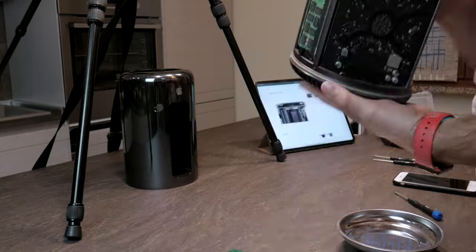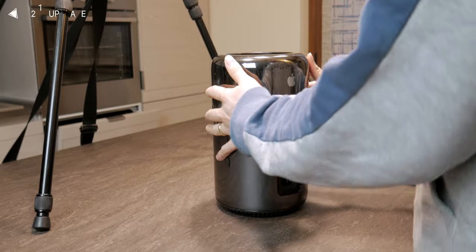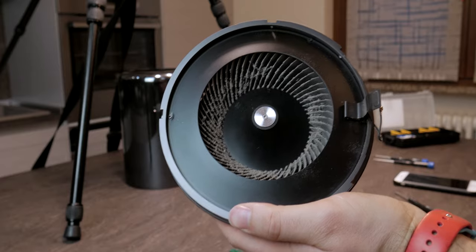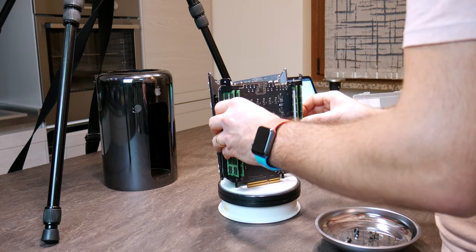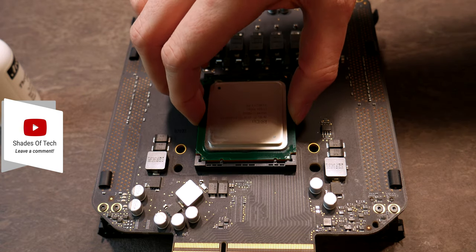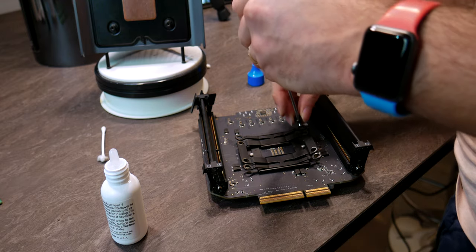If you are interested in the upgrade process, be sure to watch my next video where we will focus more on the steps and experience of the upgrade, while in this video we'll focus more on the performance improvement. To access the motherboard you have to remove the metal cylinder-shaped cover and then disassemble almost all the Mac, starting from the top single fan and then dividing it from the I/O and the dual GPU assembly with the heatsink. Once you free the CPU it's just a matter of removing the old and inserting the new, and of course reapplying the thermal paste. For me it took about an hour and I found this process really simple following the iFixit guide — it was even simpler than the iMac upgrade we did last year.